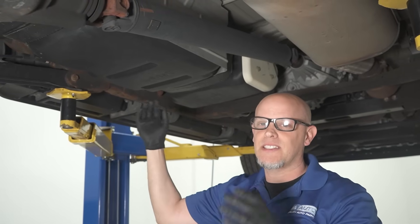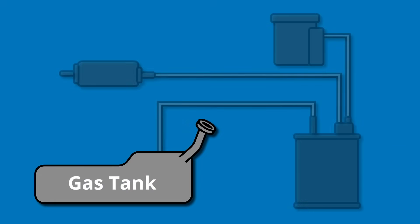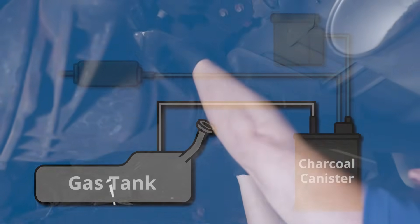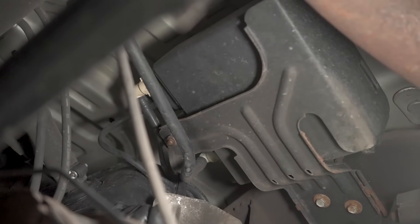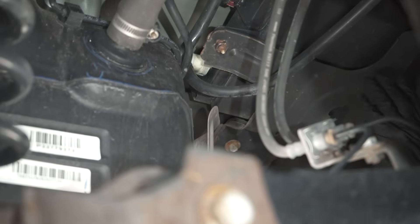When you go to fill gas into the tank and the vapors are in there, they need somewhere to escape — so that's where they go to the EVAP canister, the charcoal canister located right here. This hose comes off the top of the tank, and the vapors go up this hose into the canister where charcoal traps the vapors from escaping into the atmosphere. There are two reasons why this charcoal canister could fail: it could have a crack — over time the plastic gets brittle causing an EVAP leak and check engine light — or it plugs up solid so that when you go to fill at a gas station, you're not gonna be able to fill the tank. It'll stop every couple of minutes thinking the tank is full because there's nowhere for the fuel vapors to escape, so the pressure needs to vent off.